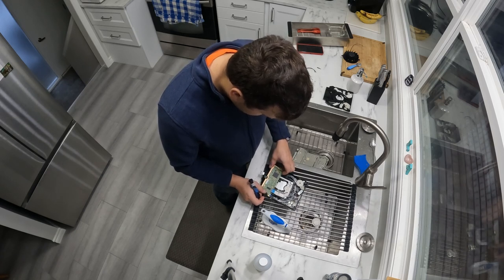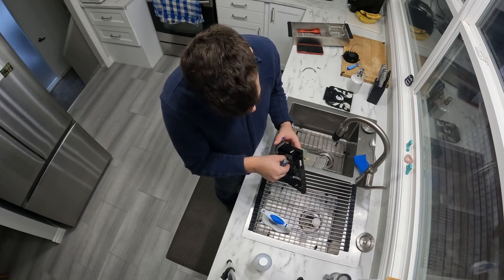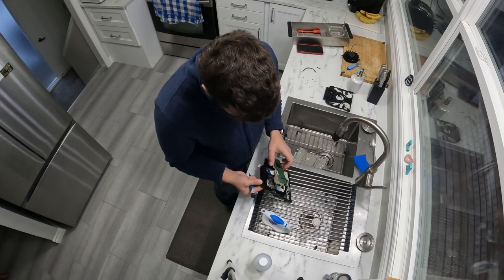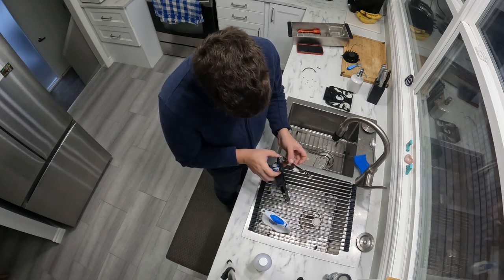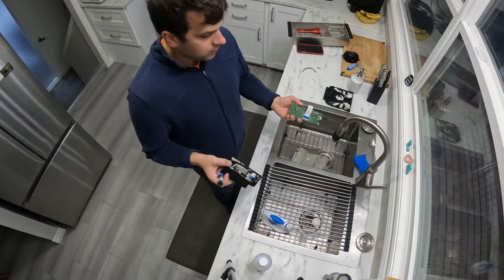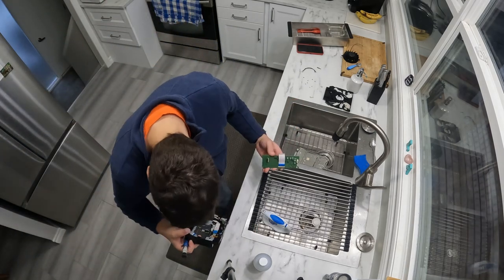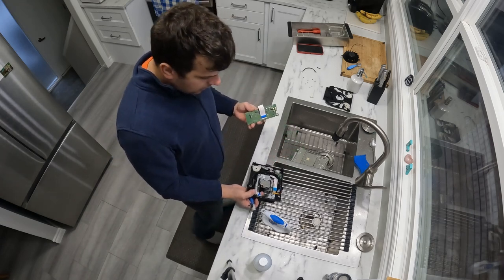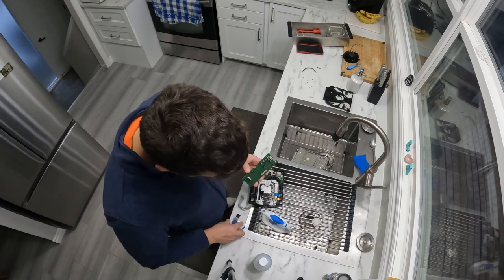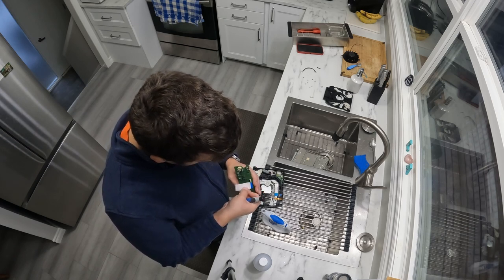And after you do that, you should flip it over and disconnect the laser from the top side of the drive, which I didn't do, and now I do. It's a little clip there that pulls up. Just use your fingernail to pop it up and pull up the cable, then go back to the back. Detach the clip there, and the daughter board will come off from underneath the housing of the drive, and you'll be free to remove it.